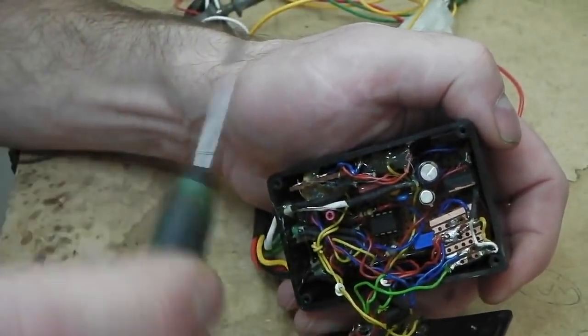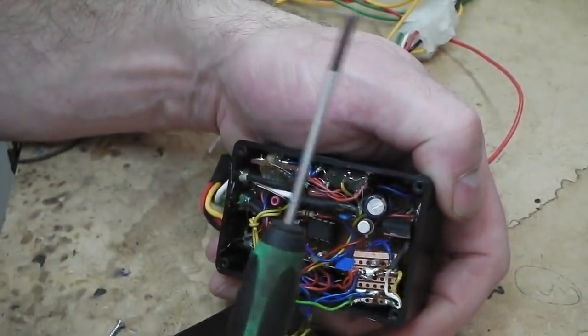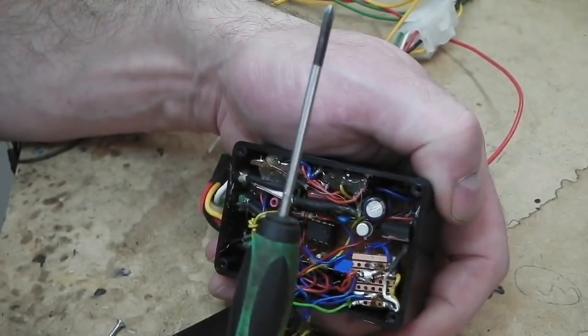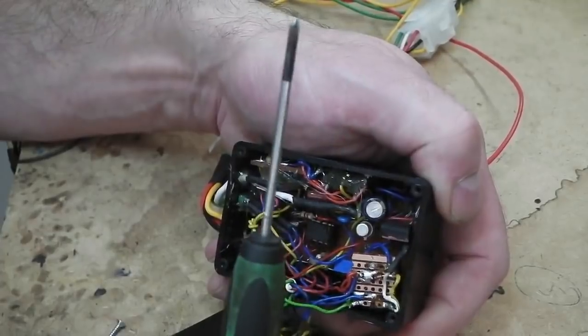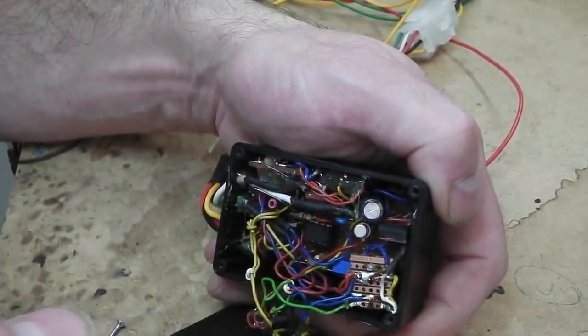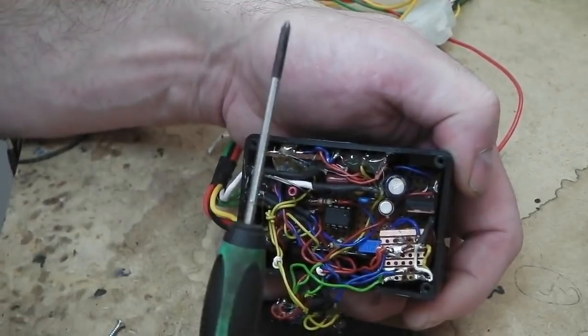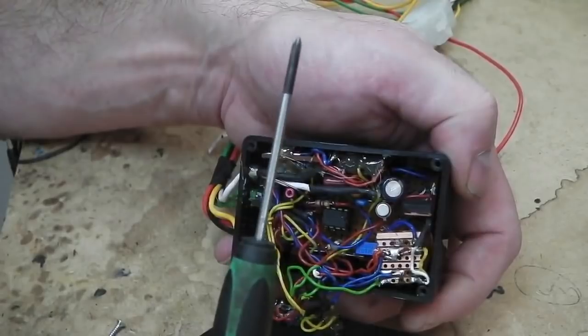Same on pinball machines, actually, on your flippers. A pinball flipper has two coils. Whack brings it in, then the second coil takes over and holds it there, so you're not having a heavy current holding it and getting hot. Same on the kickdown solenoid on the gearbox, a massively heavy current, boof, to get it there, then a small little mini winding just sticks it in place.